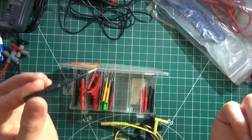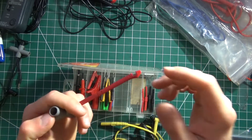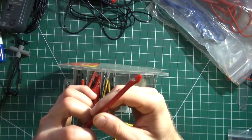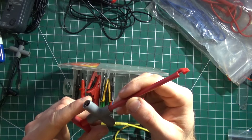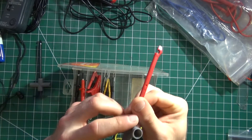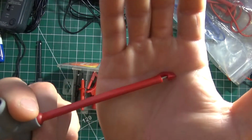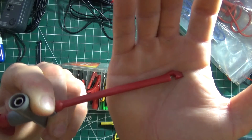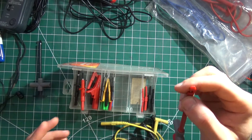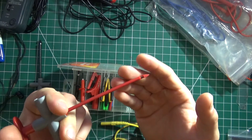You'll be using those a lot. Similar to T-pins, but I'll get into those in a second. Then you've got hook probes — spring-loaded hook setup. I've got a black one and a red one. It's spring-loaded, so it can go one way or the other. Nowadays getting into the wiring of cars, if you can't get to the sensor directly but you can get to the wire going to the sensor, you can hook-probe it and get the measurements you need.